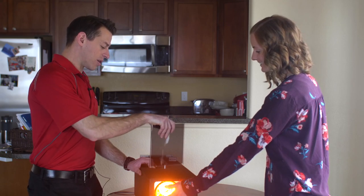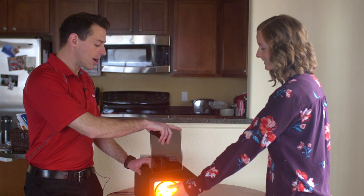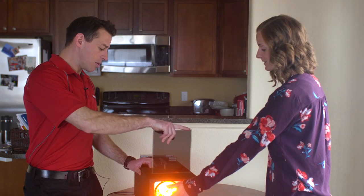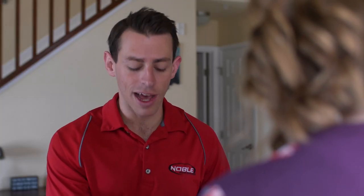So what we have here is a stock film. This is what we would put on a car. It's not designed to block a ton of heat, but we want to have a good point of reference so you know exactly what you're getting. So tell me what you feel when we drop this in front. Minimal difference. All that energy is just passing right through the tint, passing through the glass, and coming right in your hand. Not doing anything there.